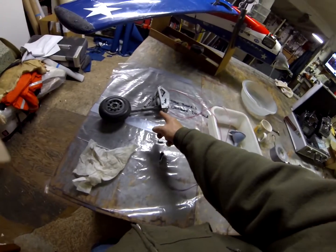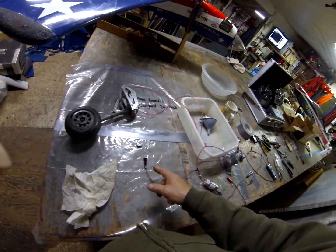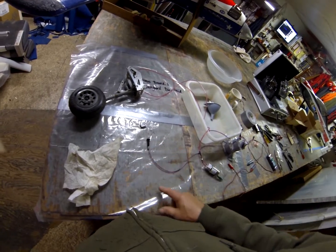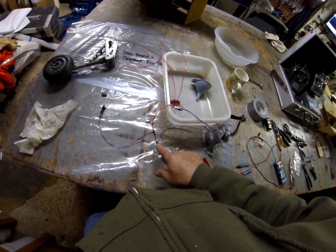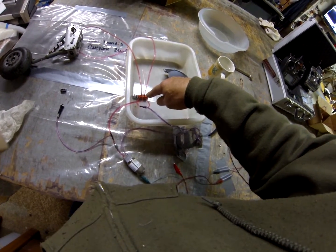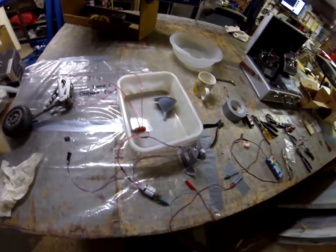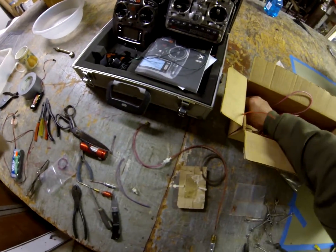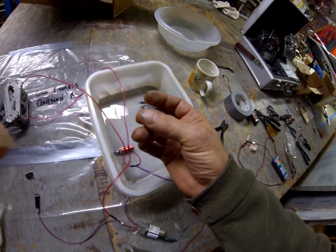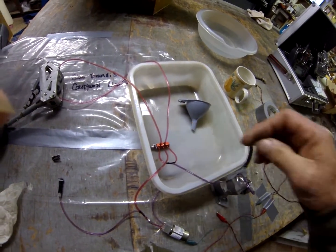The gear is air-operated. There's a micro switch, an air pressure indicator from Robart, a check valve, and a Robart controllable bleeder valve which I modified by taking out the two bleeder portions and putting two regular nipples back in.